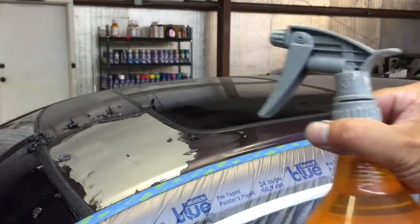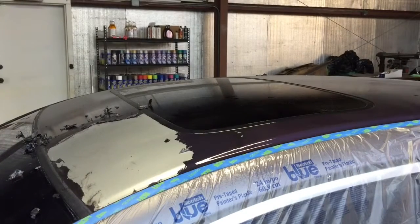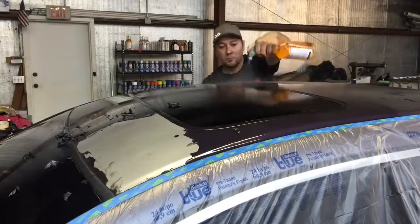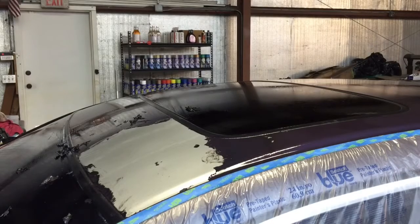Right now I'll just install the cap and spray nozzle. You want to soak down the area. Okay, so that was a full wet coat. As you can see in this front corner, the dip is fully wet with Dip Dissolver — that's very important. You want the dip to fully reliquify, you want to have a nice wet coat of Dip Dissolver on the surface. You may also have noticed that I'm indoors. I prefer to do this on a cool panel indoors because it gives you the best amount of working time.